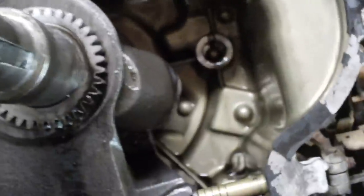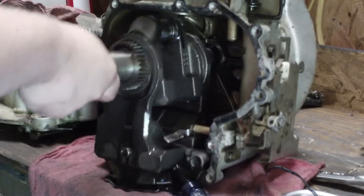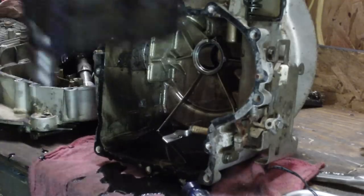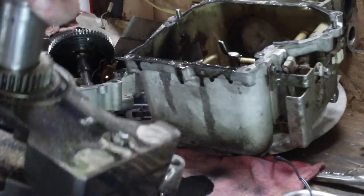Now what we're going to do, I've got to pull the crankshaft out. You don't have to pull the crankshaft out to rebuild an engine — I'm just doing it because I'm going to clean all this sludge out really good. It's going to be honed out so I don't want any metal particles inside of it. This is probably the easiest part of the whole project — just grab a hold and pull it out. I've got oil all over me. I should take my own advice and drain it out better.